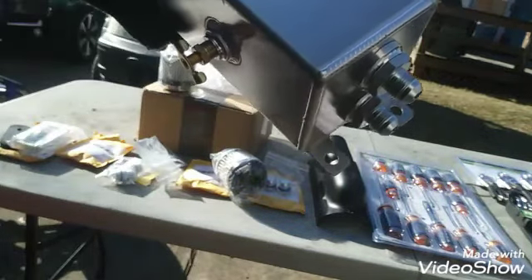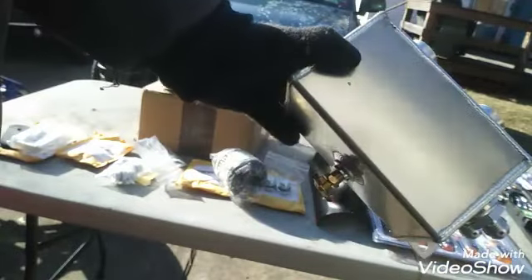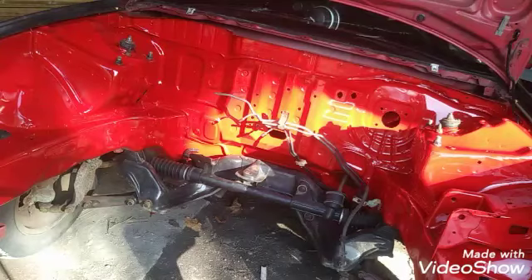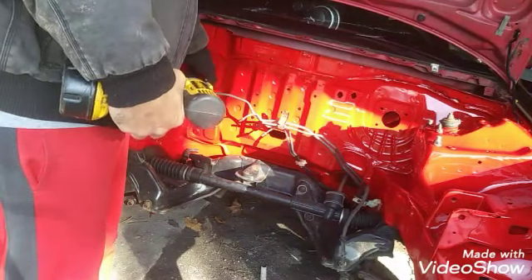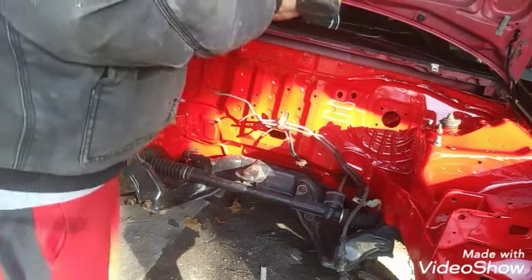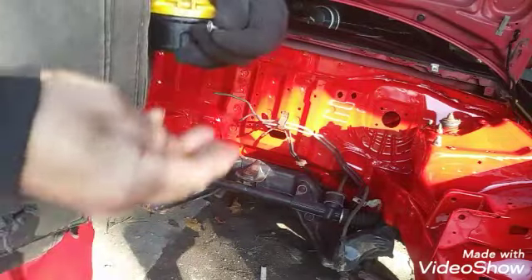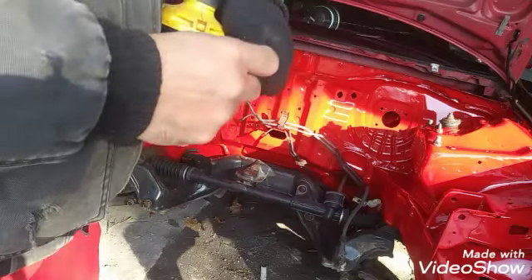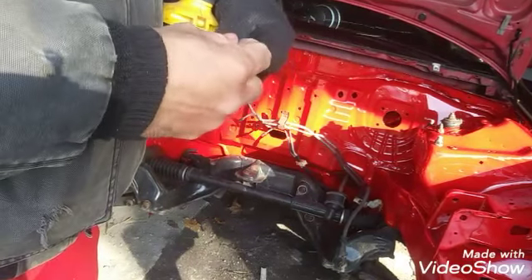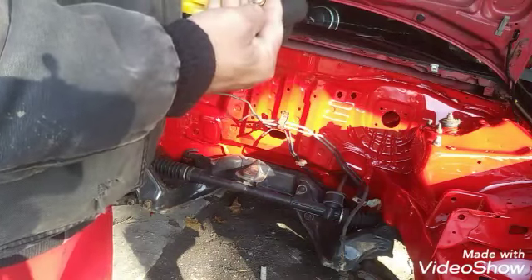Just like that — not too chubby. Right there, I did my markings already. I measured what I wanted, so I did four marks with a tire pick, and it's pretty simple. We're just going to put self-taps in, but when I put my self-taps I'm going to use these JDM fender washers so that the screw doesn't really go all the way through on the catch can, so they have a better grip. It kind of looks a little nicer too, so that was good.